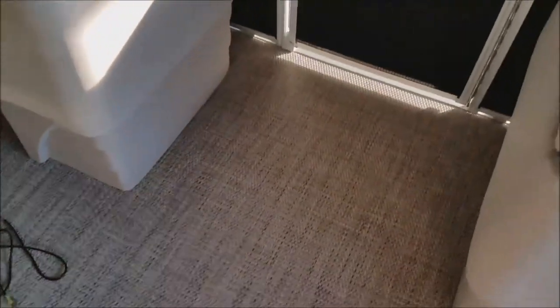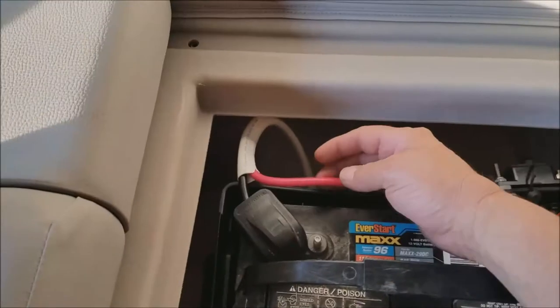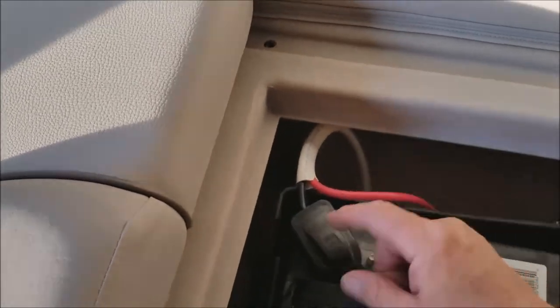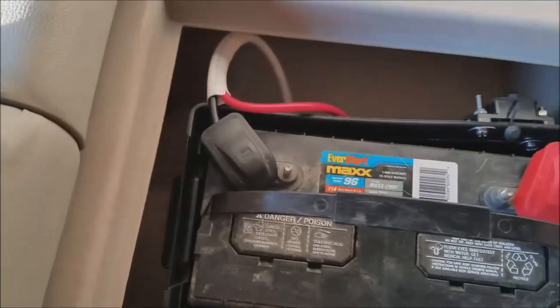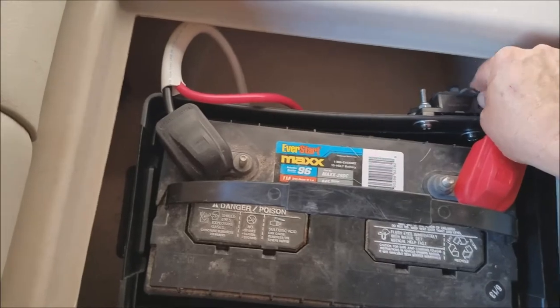Here's my nice new floor — it's SeaGrass. I had the regular vinyl on it, there was a crease, so they took it back and put this SeaGrass on and we're really liking it. For the battery, I came right here — it looked like a natural spot for it. I ordered this battery online from BestBoatWire.com; it came pre-made. I cut off the original connectors and put on the Minn Kota snap-downs, which I like better.